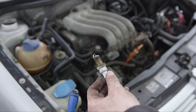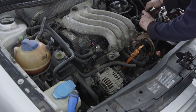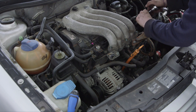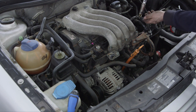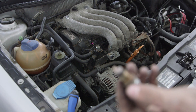This third one's not as bad, but still not a bad idea to replace it. And on to the last one — this is the one that I'm pretty sure caused the issue, because my check engine light flashed four times telling me it was the fourth cylinder. Look at that — that's pretty bad, a lot of corrosion.